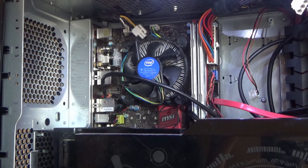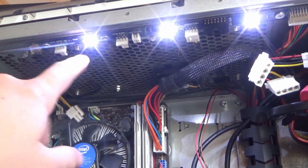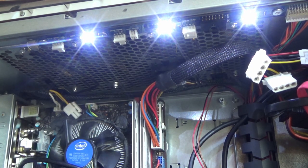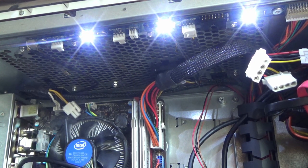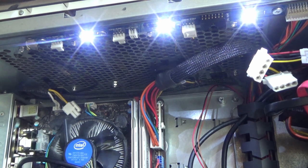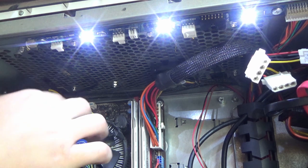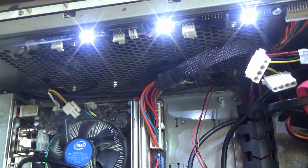When it comes to the fan situation on the OG Alienware parts, you have this array up here where you basically plug all the cooling stuff into, and then it just masters everything with an MIO board. However, I did not want to risk that because I don't want a 10-year-old component controlling my brand new motherboard and potentially failing or bugging out because it's not Alienware or Dell stuff. So what I decided to do is just essentially let this be as it is. I just plugged everything into the motherboard, same with that. And of course I don't have any fans plugged in at the moment to the system fan header, but you could do that.